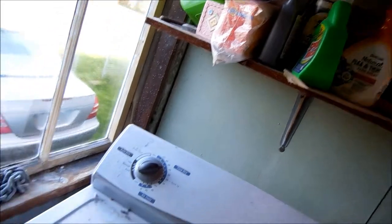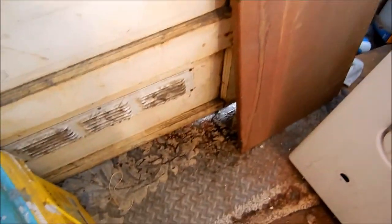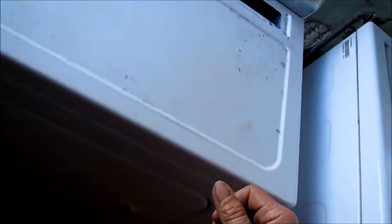That thermal fuse blows when the vent is kinked or you don't have airflow into the room. We have plenty of airflow here because there's a gap in the floor. We're going to turn it on and look down the viewport — there it is right there. By now it should start to glow, but I don't see any glow, so there's definitely a problem. It's an ignition problem.